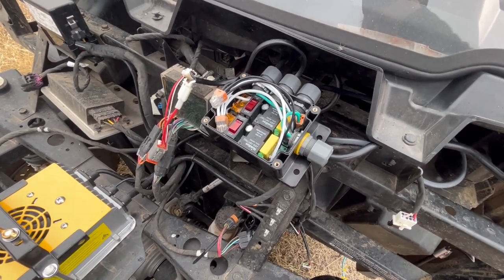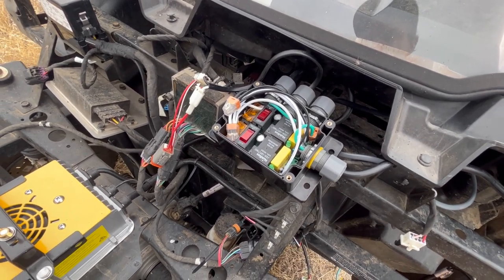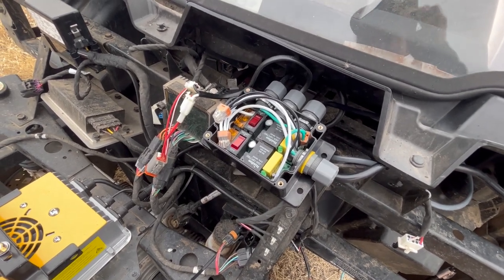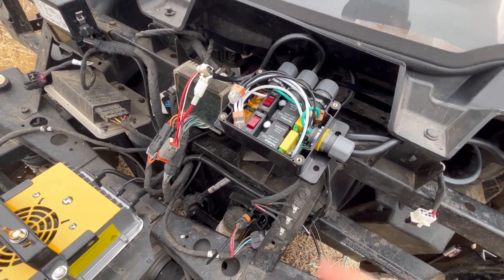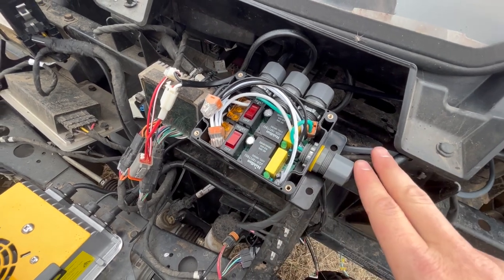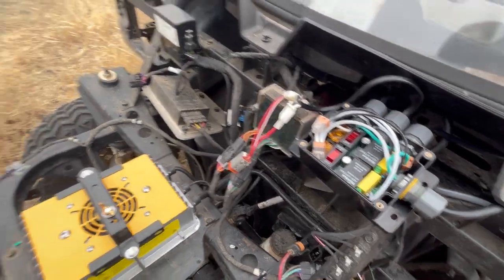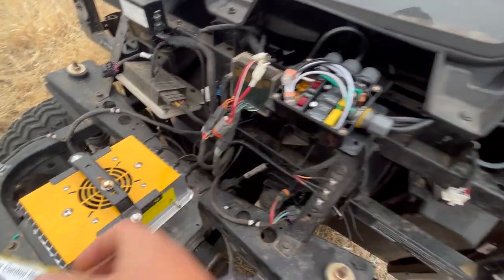The other thing I wanted to do, which may not be required for all installs, was add a level of safety so that if the charger was attached and charging, the vehicle would be inoperable — mainly for people who maybe aren't super familiar with the setup, or just to prevent accidents. Part of the reason this took so long was finding the right parts. I wanted to control some relays with an AC input, but I was controlling a 48 volt output in the case of the switch. That was hard to find. I'll put the link in the description. I ended up finding these power control relays, and I think they work great.